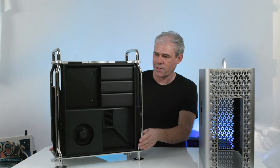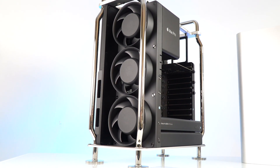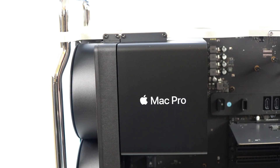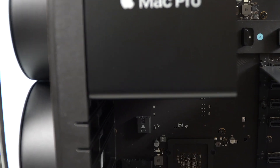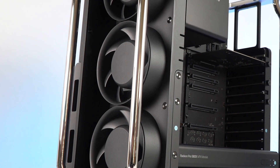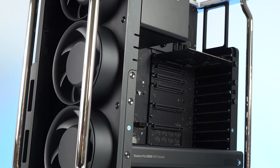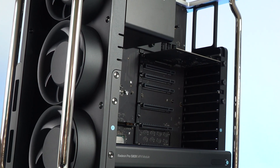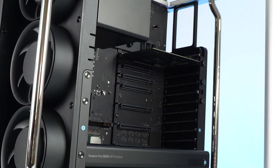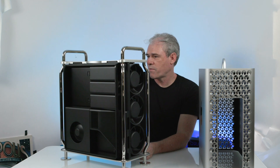So if we look at it in the front here we've got our fans — three fans — to provide lots of circulation. And then here we have our logic board. Let me turn it around so you can see it. There's all the good stuff. If we look up here we've got our processor and power supply. Looking at the PCIe express slots, we've got four double-wides. We've got four single-wides, one of them is a half-length which has the IO board — that's where our Thunderbolt ports and everything go. And then in here we've got more ports so we can plug things in.